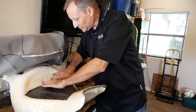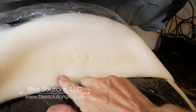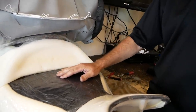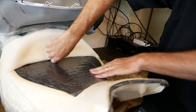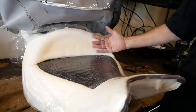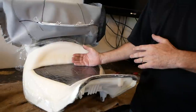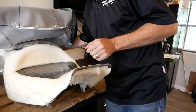If we take a look at this back area, you can actually take your finger and feel that lip right there. That's the lip we're talking about. The problem is this whole heater element has to be removed in order to address that. So if somebody's thinking they'll just pull the cover and cut that — you have a heater element that wraps along the face and wraps all the way underneath that cover. The only way to modify it is to completely remove this heater element, do the modification, and then put the heater element back in a way that nothing shows through the vinyl. It has to be perfect every time. That does present some challenges, but since I've been doing this since 2004, I actually know how to do that.